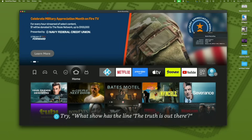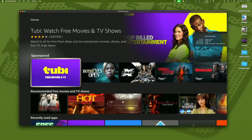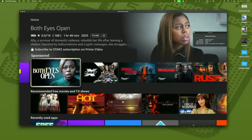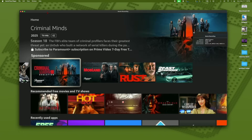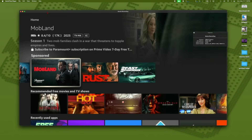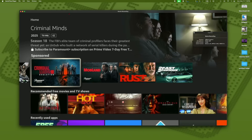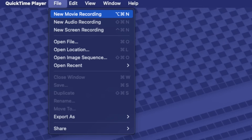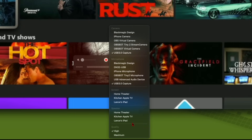Another use is video recording. I've got my Amazon Fire Stick plugged directly into it. I'm not condoning this, but it bypasses HDCP copy protection and records audio in stereo. You can use QuickTime Player to capture a movie or TV show. In QuickTime, go to File and select New Movie Recording. Once the window is open, make sure you select your camera — USB 3.0 capture — and your microphone, USB 3.0 capture. That is the capture card.